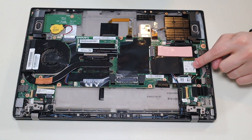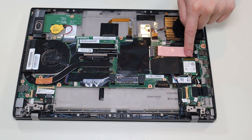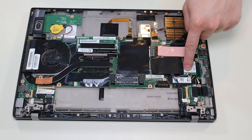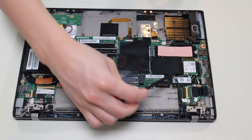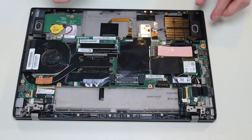Your Wi-Fi card is right here. It's held in by a single screw there, plugs into the motherboard here, and the antenna wires snap on in that corner. The black and the gray wire — those are just snaps, so those snap directly up and off of that Wi-Fi card. I'll use my small flat plastic pry tool and just snap that one off, snap that one off.